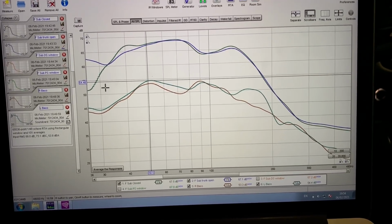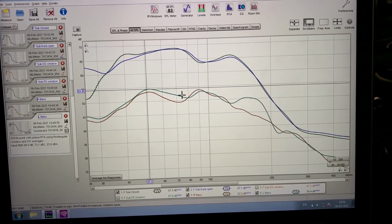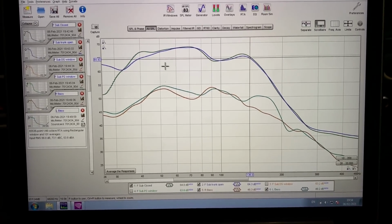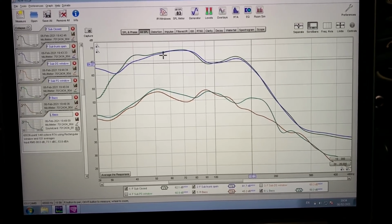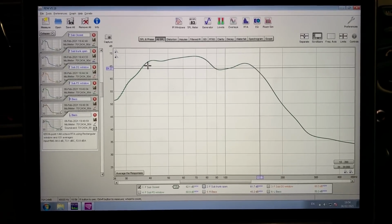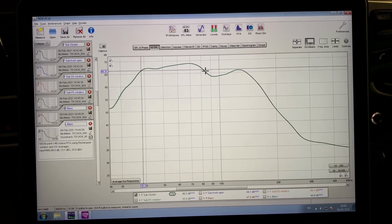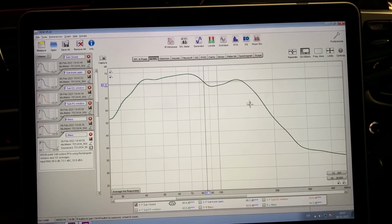So these are your underseat drivers and the dip that we had over there that we couldn't really do much with. But not just that, now I listen to the front sub and everything is so clean and with such an impact that yes, the underseats were just not really able to deliver. So this is your front sub with no high pass filter and a low pass filter applied at 150. There's a healthy level, definitely very healthy level. I take those out. So this is when the car is completely sealed. It's functional from 40, so we need the rear sub for the low end wobble, but it's very playful and clean, and we have pretty good level all the way up to 85. A bit of a dip, but other than that, it's pretty good.